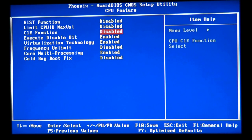In Windows, this C1E function switches the multiplier dynamically — whenever you're not using the CPU at full load or it's idling. It does this to save energy and cool down the CPU by lowering the frequency. Lower frequency generates less heat, and it also lowers the required voltage, which further reduces heat generation.